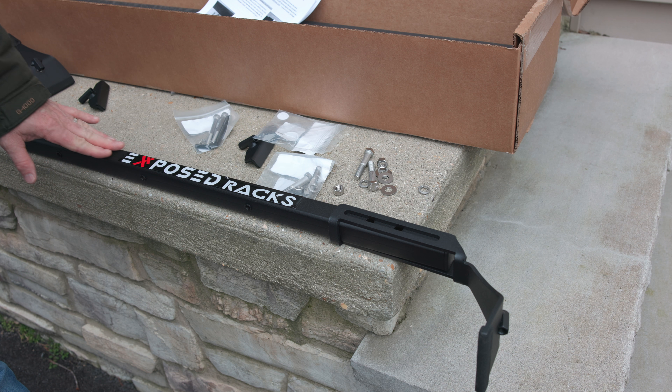The first mark is the edge of the iKamper rooftop tent. The next mark is where the crossbar goes — 8 inches back from where I want the edge of the whole setup. Then 21 inches gives us the middle bar spacing, and another 21 inches tells me where the back rack goes. To double-check: if I go 8 inches past that back mark and hold it there, sliding my tape down, I should have exactly 58 inches — and it does. Now we need to install the weight distribution feet.